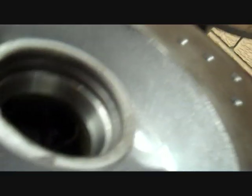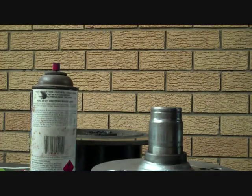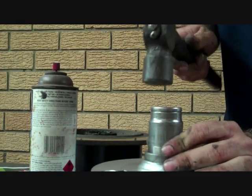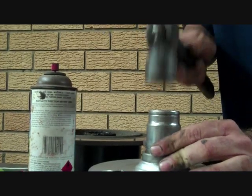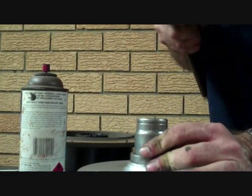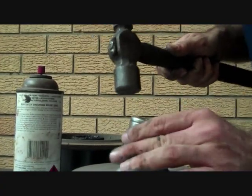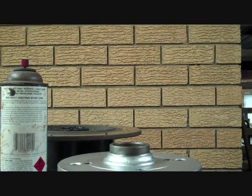And you'll know when it's fully seated. You'll be able to see it's sitting against the bottom ridge there. So flip over, rinse, lather, repeat with the other race wherever it's gone. Again, large side goes in first so it tapers outwards and nice and square. There it is, home and hosed.